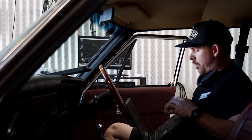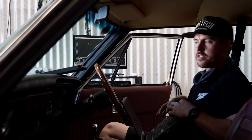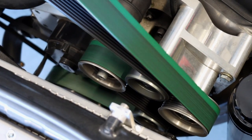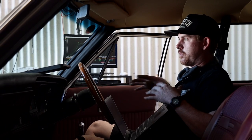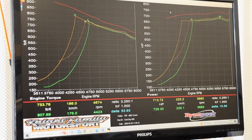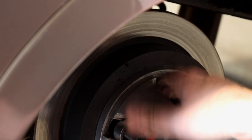Before we started, I went through, switched the fuel, and made the appropriate changes to feed forward the changes in the map for the ethanol. This is not our first time tuning these engines, so I already knew roughly what ignition timing it wanted at these boost pressures to move to 98. Credit to the Haltech - when we've gone and run it, the fuel model has done the heavy lifting for us. Even the first pull, I did a couple of ramp-up runs and could see everything was almost bang on already. Did a wide-open-throttle pull - the car made 714 horsepower, almost exactly what it did on the hot day in December when we tuned it on E85 last time.